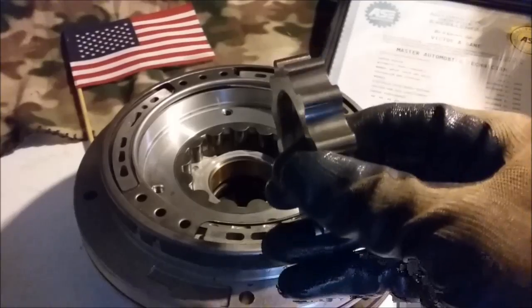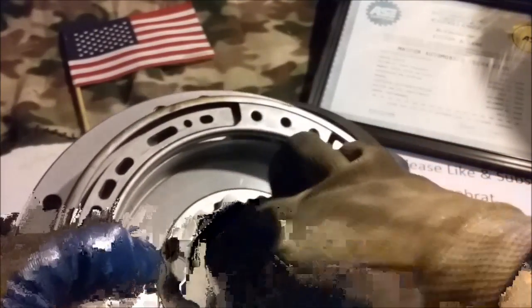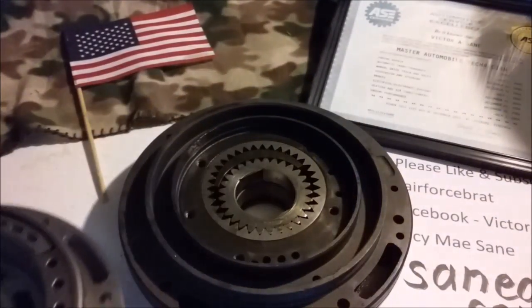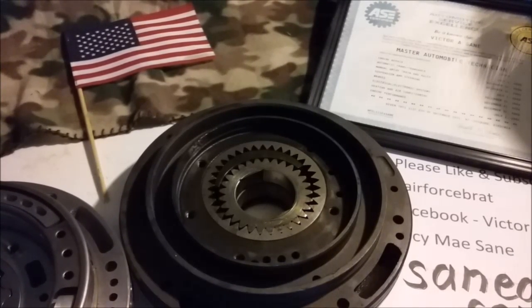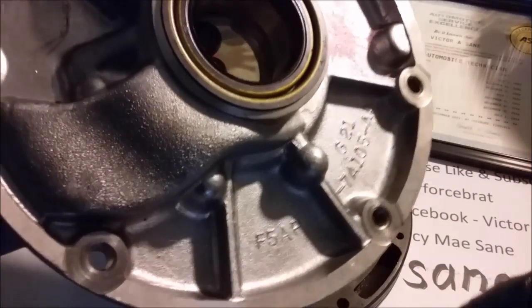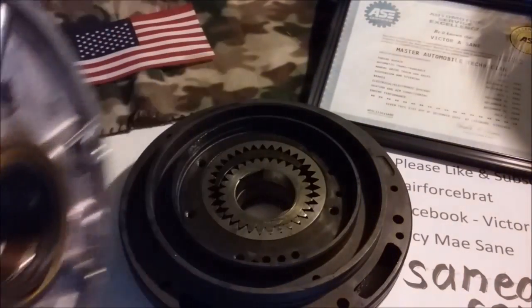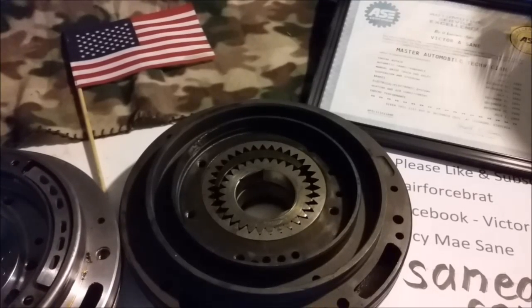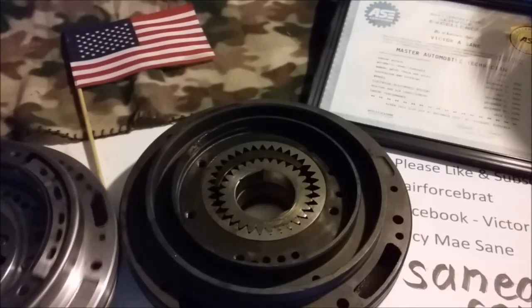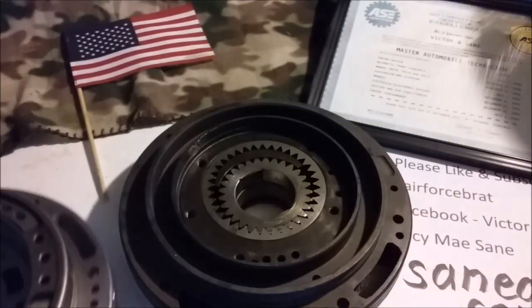These gears got even thicker in 2006 when they changed the pump again, and the gears went to 0.655. In 2011 I think they made another change but we need to do some more research on that. The best thing you can do, if you're working on a transmission and you're relatively sure it has the original pump, is to match up your casting numbers — Ford is really good about being consistent with casting numbers. If you match up the same casting numbers you can be pretty certain you're working with the same pump. And pay close attention to your feed holes and look for any differences there.